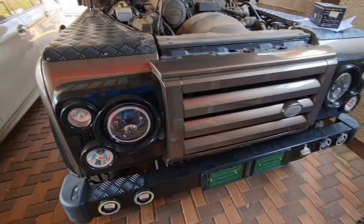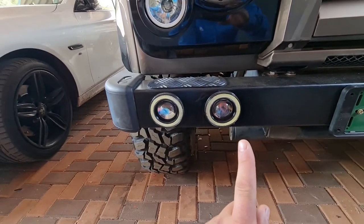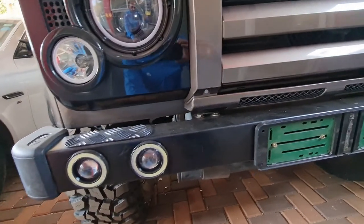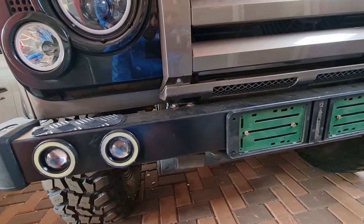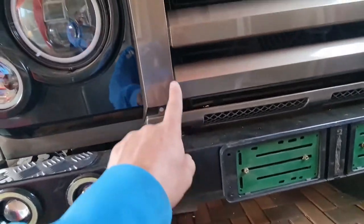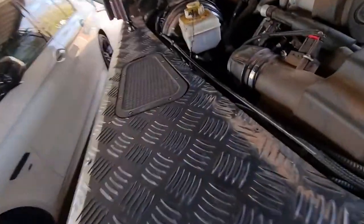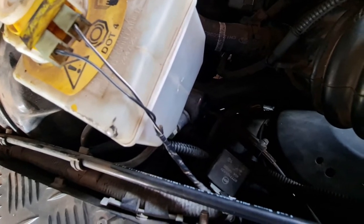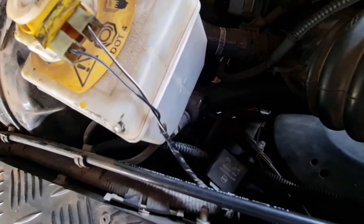It's a bit dark sorry about that. Everything looks good and it works. I've already connected the daytime running lights and also connected the fog light while I was under the car. I had an ARB bumper previously and I used the wiring for the spotlights from that bumper — that wiring goes up against the radiator on the side, earthed on the body, and I've got a relay connected on the brights at the steering column. I'll change that to a proper switch going forward.